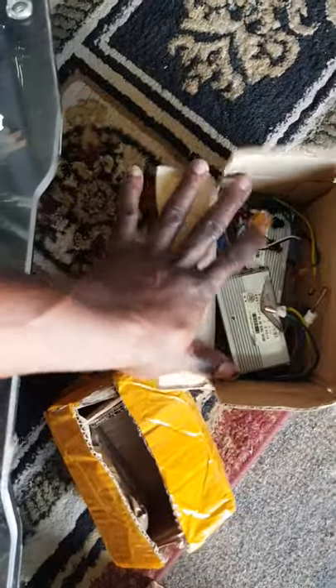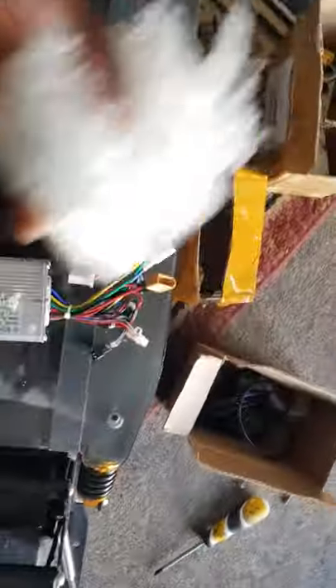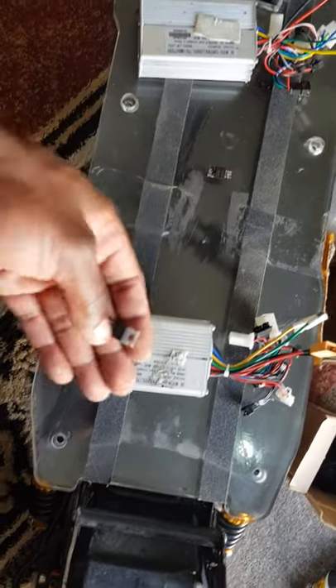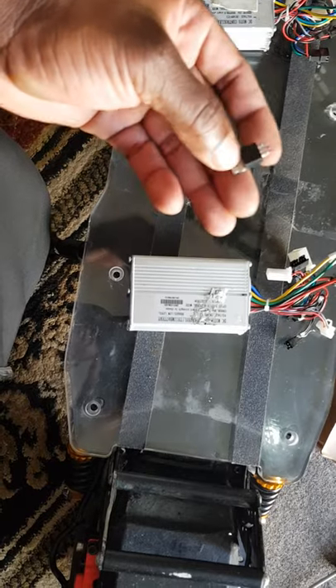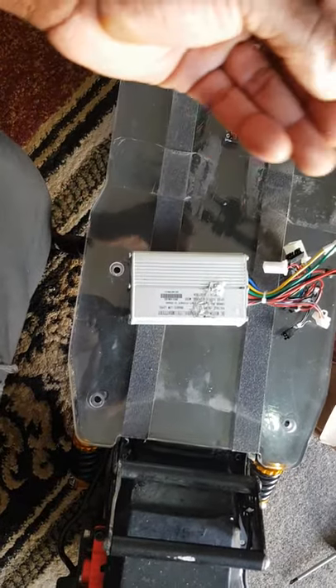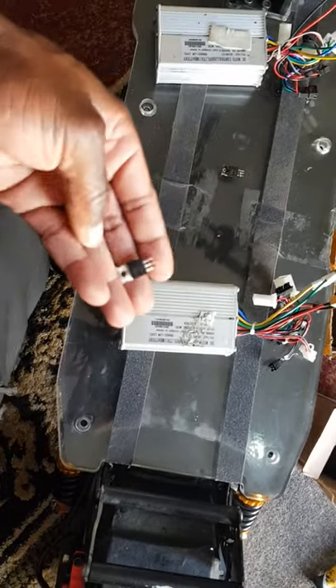I got some parts here — these controllers are the ones that go with this scooter. I did a controller change on this and decided to do that alongside my QR1 video since it's the same procedure. The MOSFET I ordered — if you're looking for one for a 48-volt 25-amp electric scooter controller, it might not be QI-specific, it might be for any other electric scooter controller. You might be able to find that on a shop called E7-something on Amazon, or you can get it on eBay as well.